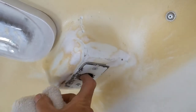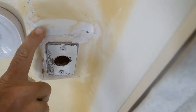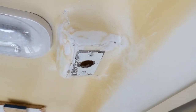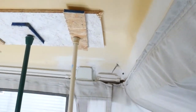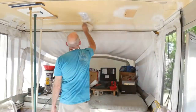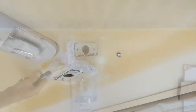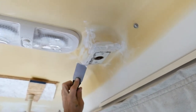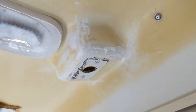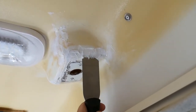This is the one at the front of the camper — it's pretty strong, but we missed a couple spots with the MEK or the ABS repair stuff. I'm going to MEK this again, rub it down, and take some of our ABS repair stuff and give it a good coat. You want to work fast and use a little bit of this stuff at a time, because it starts to dry and bond and thicken as soon as you put it on.